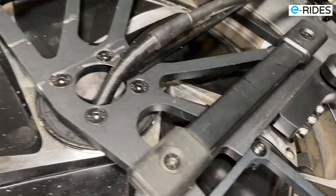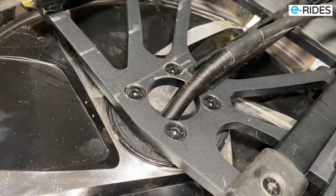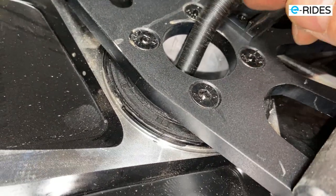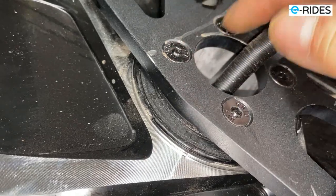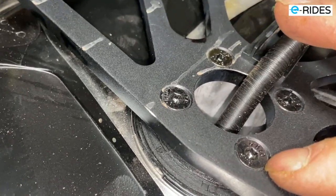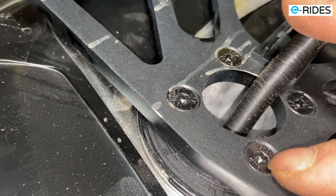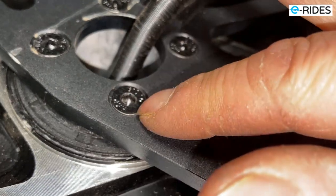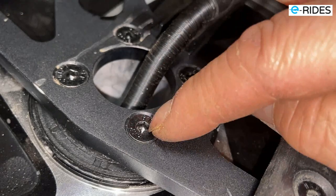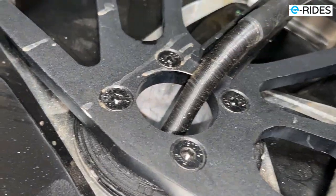Because I have so many screws that slipped, and you need to heat it up and try to turn it. But they're quite near to cables. So for instance, this needs to be heated up to unscrew, because the size of the screw is big, but the thread that you turn is too small. So the weight is too strong for the thread. Therefore, this will slip. It's the wrong screw they use.